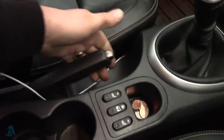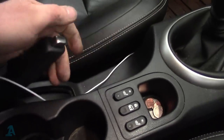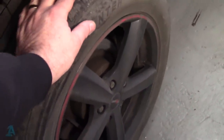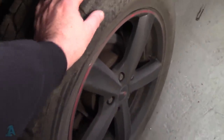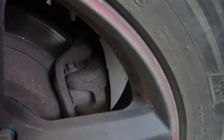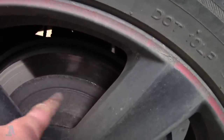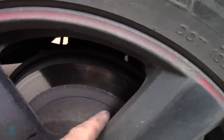Parking brake comes up quite a long way, so let's leave it on. Driver side, offside rear — that is locked. Passenger side — free spinning, not working at all. So the setup on this, you've got a rear brake caliper, you've got your disc, your rotor there. You're going to have parking brake shoes that run inside this part of the disc like a brake drum.